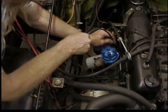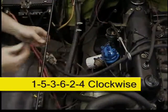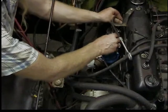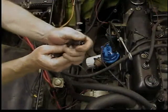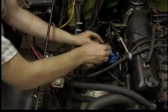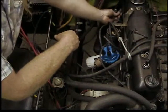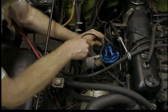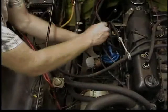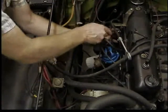We remembered where plug number one was on the distributor, so we've got to get that right. Then just go through the standard firing order on a Jeep: 1-5-3-6-2-4. Plug each wire in order going clockwise around the distributor. As you do this, make sure the boots are pulled back so there's enough wire sticking out to get down into the connector on the distributor — press them all the way down in. Same thing on the plugs: make sure it snaps onto the spark plug cap. Get all six and hook the coil wire up — the middle one goes to the coil.